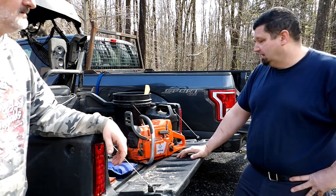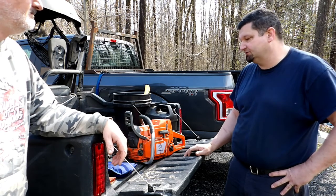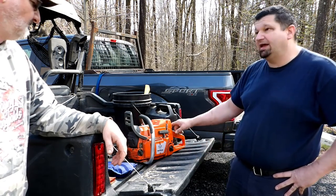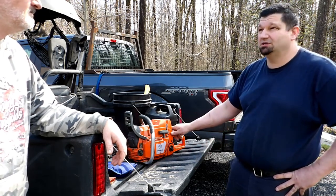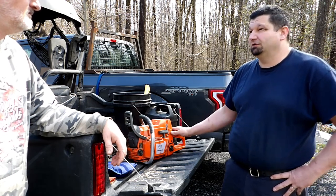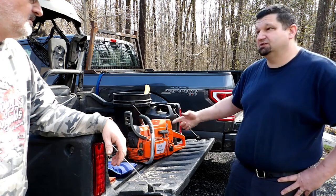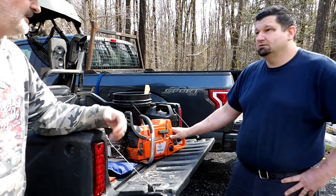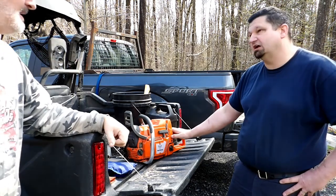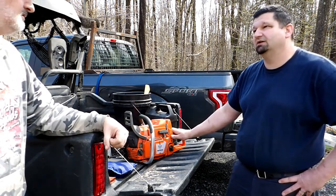So I bought on eBay, or Amazon, I don't even know which, a little package of the little push bulbs for it. Check valves. It's not really a primer. You can pump them all day. It won't flood the saw out. It just flows new fresh gas into there. And so that's on mine too, right? Yeah. Okay, so I can't flood that. You can't flood it by pushing the primer. You can push that 20, 100 times, whatever you want.